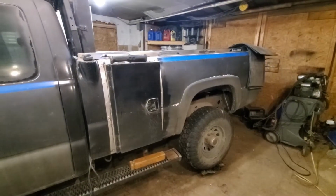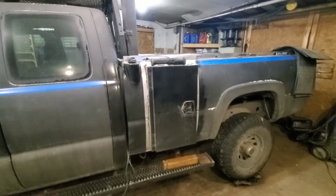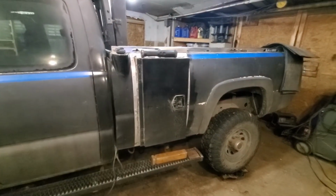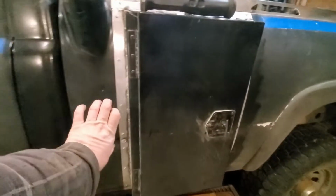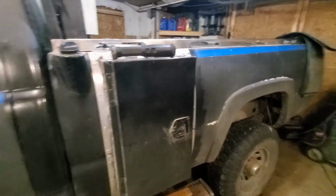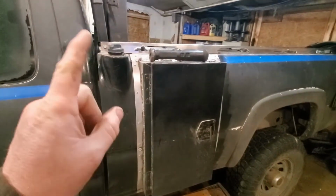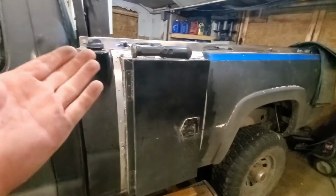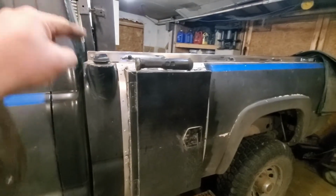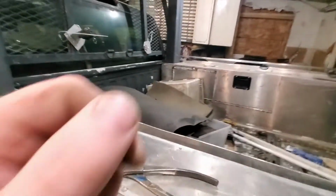So yeah, if it's dead empty, I can run that on the highway while still driving if I have no stations I've hit in the last while. I flip a switch, it pumps in, but unfortunately the last time, it pisses out the side and sprays down the side of the truck, which I have had happen. I've been stopped for it. The trucker didn't like that much, but hopefully I can solve this problem, that I can get somewhat of a pressure valve that'll hold it down there, and then once it hits a certain pressure, that thing will kick out. That's my next plan. I got to get a pressure gauge that's low enough that'll kick it.